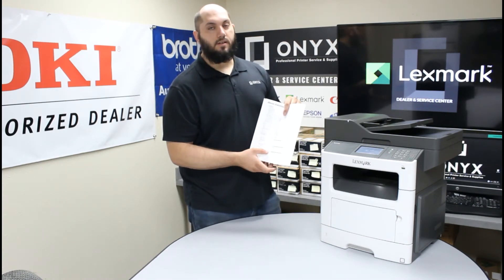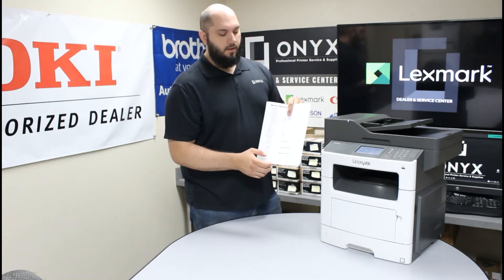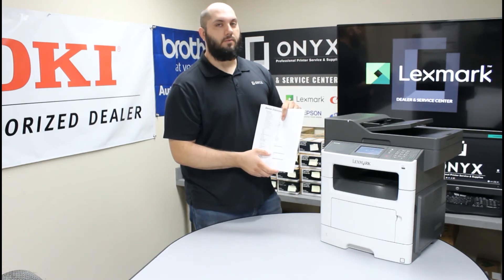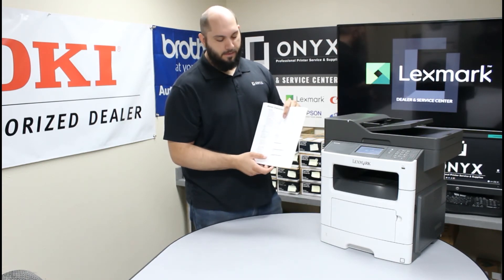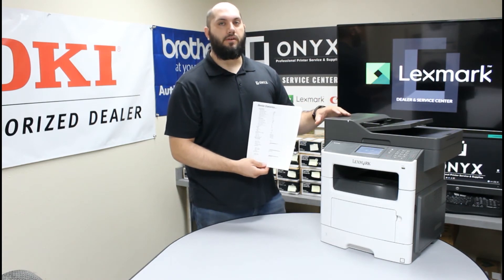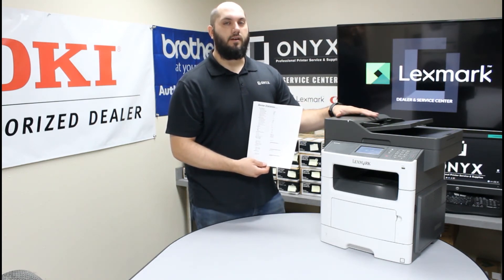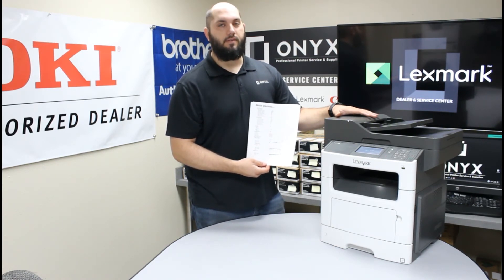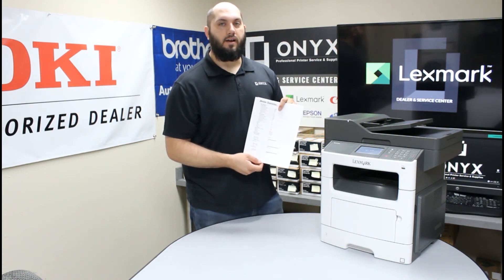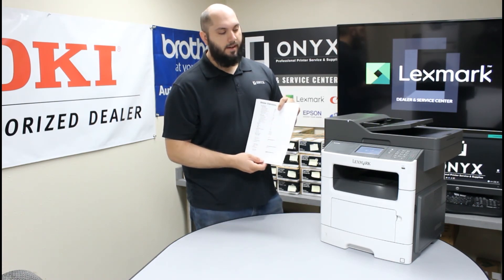The second status bar in the middle is for your imaging unit, which is the device that goes underneath the cartridge. That's another common item a lot of people overlook — it needs to be replaced as well, and it happens quite often where the imaging unit runs out right in the middle of a big print job. The last one is for your maintenance kit, which is very useful information so you can keep an eye on where your maintenance kit is and ensure the consumables for your machine are replaced in a timely manner, so you're not caught needing a replacement right in the middle of something important.